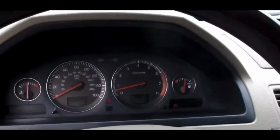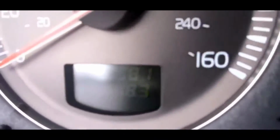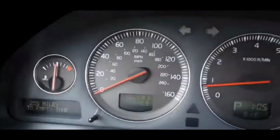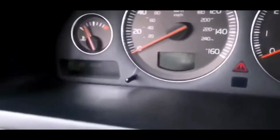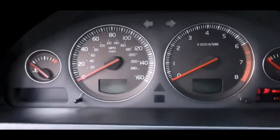Next thing you can do is you can check the car battery voltage. Just because the dash lights are on, it really doesn't mean that the battery can be ruled out. The battery could be partially discharged. The remaining charge in the battery could be enough to power up the dashboard lights, which are LEDs and don't require much power. The battery charge cannot be sufficient to power up all the modules. So to rule out a bad battery, you might want to get a jump.